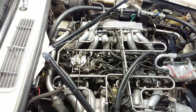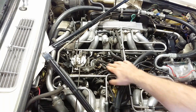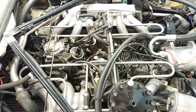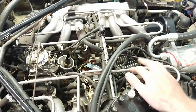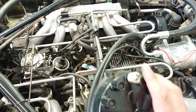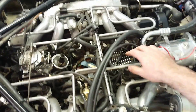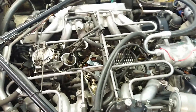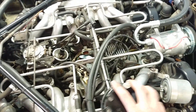I'm going to remove the distributor cap and the coil to make everything a lot easier to show. Here's a top tip: when you remove all the HT leads, you don't need to mark all of them. Just mark 1A on the cap — I've put some masking tape on 1A. Then when you put everything back on, you start with 1A and continue in the correct sequence. I can put that sequence in the description below. You can easily tell where all the plug leads come from and put them on in the right order.